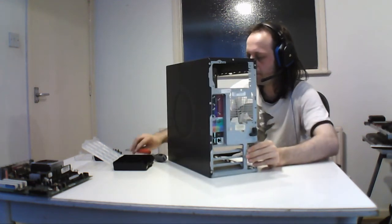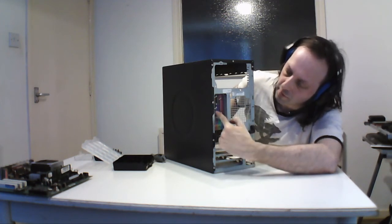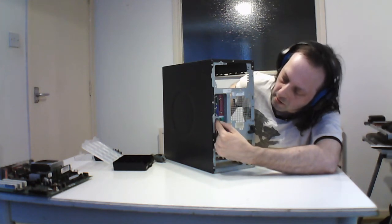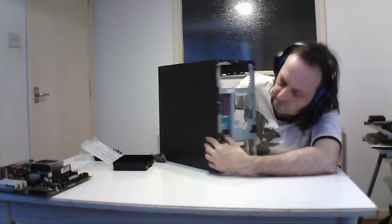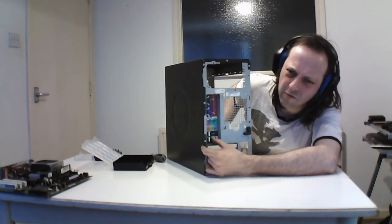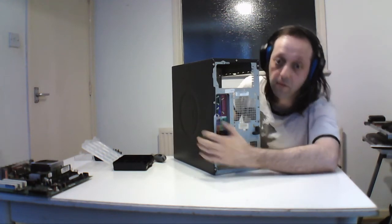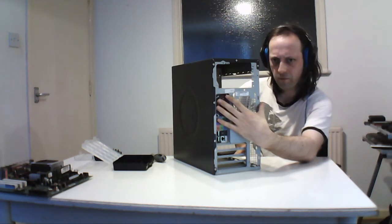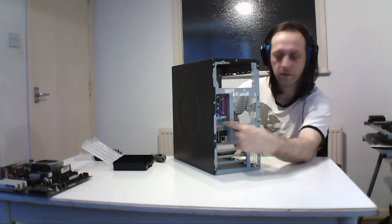And like I say, it still has a serial port for some stuff that needs it, but it's onboard graphics, and there's a parallel port for data transfer and that. Both systems had a PS2 mouse and keyboard on its own card, and this one has 4 USBs, but the other one had 2, and a LAN. I think they only went up to 100, these two. And there's 4 LEDs here on some Dell systems that have this diagnostic LED. So when the machine is booted up, which I'll show when I have this all fixed up, it lights up to show status, and if it halts, you can look at the manual, and it tells you exactly what the fault is, or the beeper.